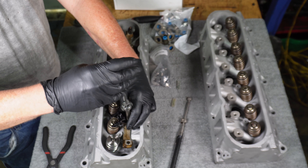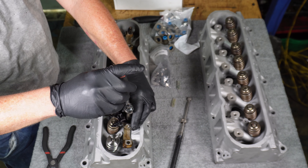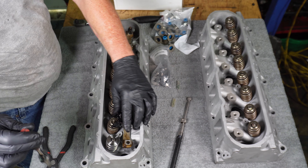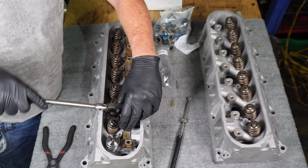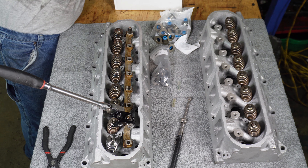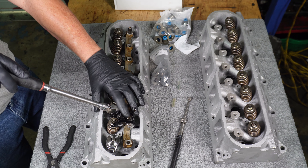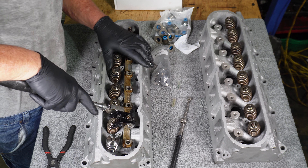These are the 6.2 heads, so I've got to angle this a little bit to get it to go in — it won't go straight. On these you have to leave the tool up a little bit so it can articulate in that direction. On the 6.2s we have one straight rocker and one offset rocker, so for the offset, to use this tool it's got to be at an angle — you can't have it seated in the bridge.